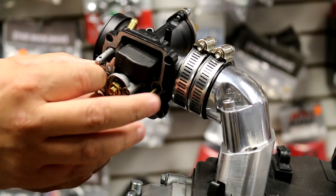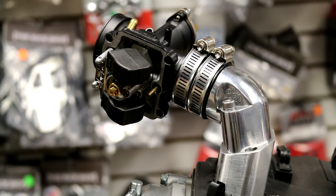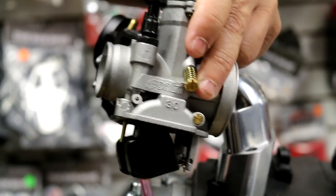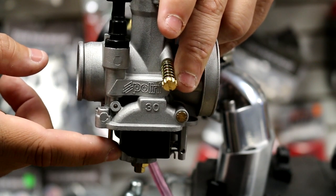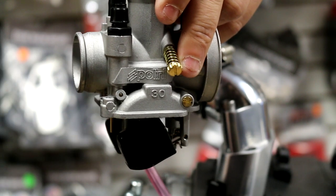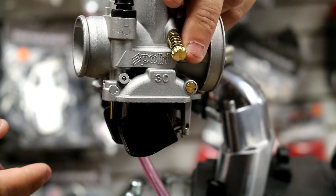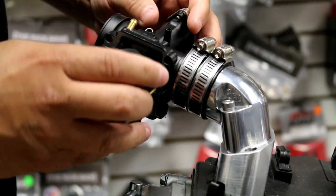Just remember, don't go too much — the more you do, you're going to have to go back. Once you get that done, you're going to put this back in, put your needle back on the hanger, line it up, and put the pin back in. It's hanging from the bottom now, so you just hold it here and slide it back. Take your time — it's very simple to do. With it hanging like this, the stock setting is parallel, and that's going to shut it off. If you want to shut it off sooner, you're going to want it not so parallel. If you want more fuel, bend the tab down. There's not a lot of room between on and off, so you're not moving that little tab very much — just a little bit. On average it takes about five times of adjustment to get it perfect.